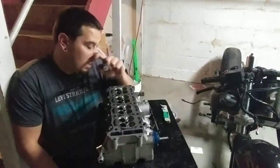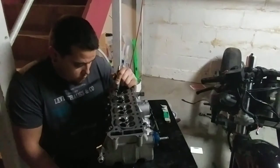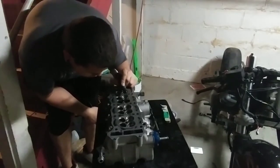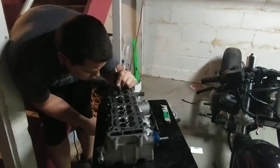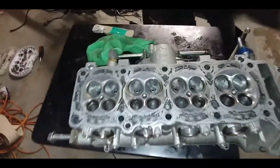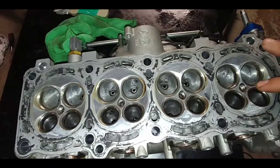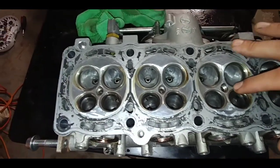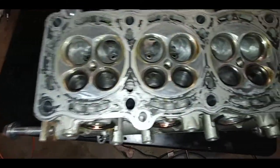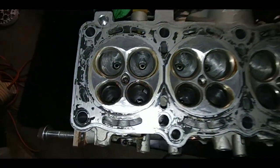You want to stay away from the valve seats too. This wasn't my Dremel kit specifically — it was a Dremel-style kit from Harbor Freight. And she is done. It's polished up pretty good. It's basically like an eraser — it's not really a sanding stone. It's all the rubbery stone material that came off and knocked all that carbon off. The only stuff I couldn't get is anything deep down in the cast — everything else came out.